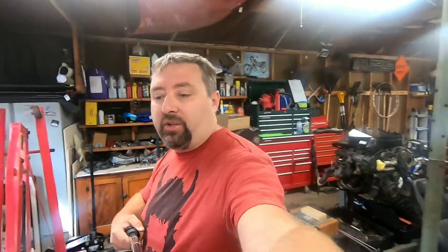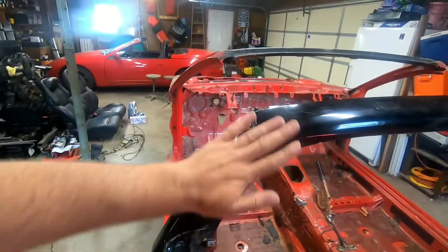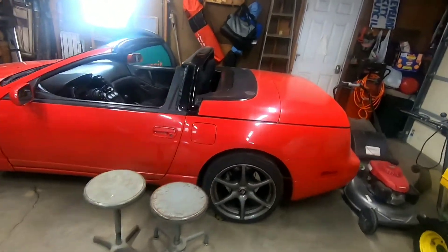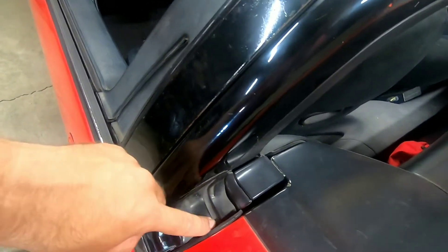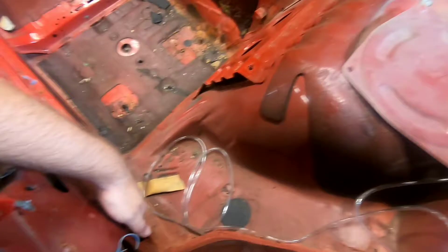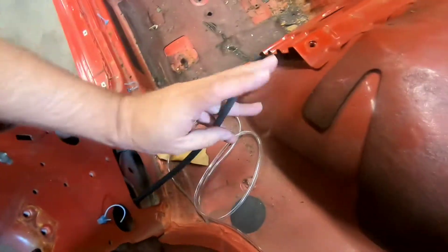So let me show you where I'm at. I've shown you before, but let's show you where they drain at. This is the roof drain. So if you've got your top here — it's down — it's right here underneath. I'm gonna show you on my car where that point actually is. There's a rubber gasket in here. I'm not sure how water gets down there — I'm assuming through this channel — it's down through there. Back over to the parts car, you can see that this can get plugged up and it runs straight down through the body, down into here. Nothing fancy, it just drains right down.